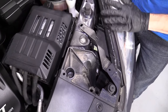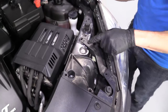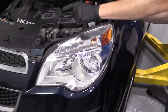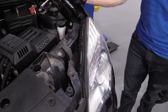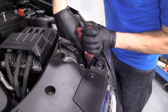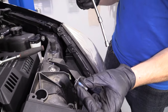The headlamp assembly is held in by a few bolts. There's a 10 millimeter head down inside this hole right here — you're going to need something with a long extension to get down in there. And then you have a seven and a seven. There's another bolt hidden right behind this fender that we're going to get to in a minute, but first we'll take off the top three. So here we go — 10. I'm going to turn it to the left. Put the magnet down in there. There's our 10.